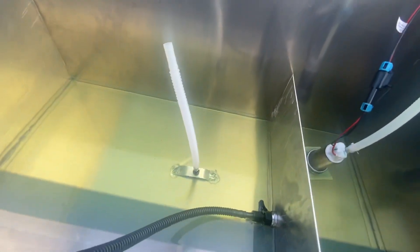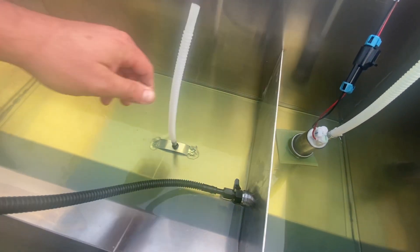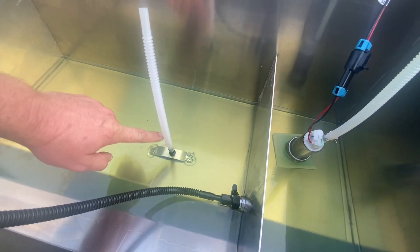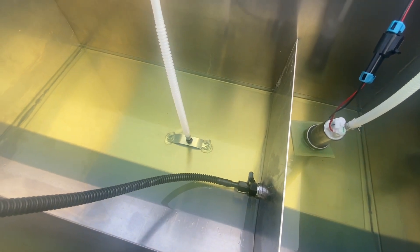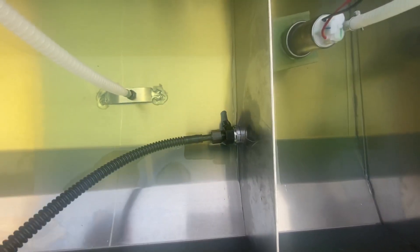The way I originally intended this to work, I had a little hump welded in the bottom of the tank with a fitting screwed in it, and I was going to have hoses connected there. But this wouldn't create enough vacuum pumping air to pull the fuel up the hose — the fuel would come up about an inch and then stop. The Venturi pump doesn't pump air very well; once it primes itself and gets fuel flowing it pumps really well, but it just can't suck air well. So I ditched that idea and just turned the fitting so that the hose barb sits against the bottom of the tank. I'll get an AN swivel fitting to lock that down.